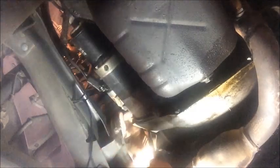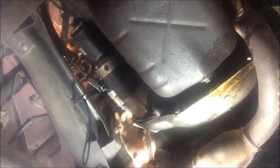And of course, I've disconnected the negative battery terminal at the beginning of all this. If you haven't done that, you want to make sure that it's disconnected right now before you make the starter make contact with anything in the vehicle. You don't have a lot of room to work between the body and the vehicle right here. Again, this is something you could do after dropping the cross member. I tend to try and get as many things out of my way before I have to work around the transmission jack holding the trans up. It's just a matter of personal preference.